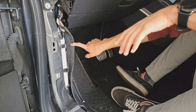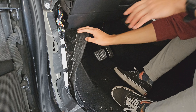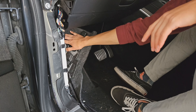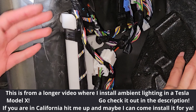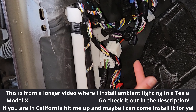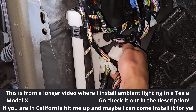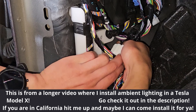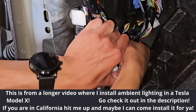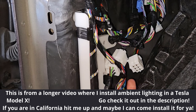We need to look at the connections behind the carpet, so pull back the carpet — it just sits against the car, so pull it away. Once inside, you'll see a large white clip. Use your finger to press the small tab behind it, which releases the lock from the two clips, and simply pull them away from each other to disconnect it.